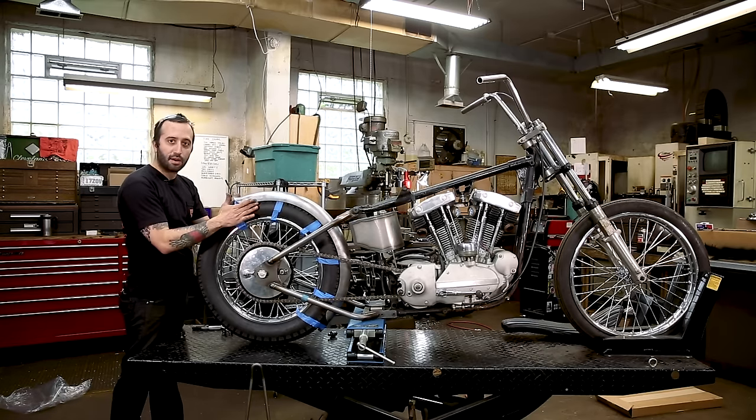It doesn't have to be perfect because we're going to weld it, and I'll be able to show you the difference between the curve that's ground into this bung versus this flat one, which, if you wanted to fill the gap, would be okay, but it would be better if you try to close the gaps as much as possible. So just lining these things up, you can tell from one bung to the other that there's just a little bit more gap on one side. You can really weld that up just fine.